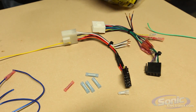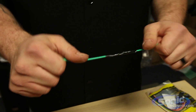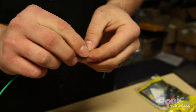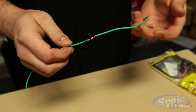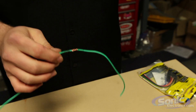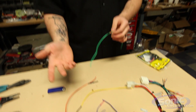Now, we got connections that you don't want to do. Quite a few different varieties I've seen in the industry. You get the twist and tape, which obviously you can see right there just comes right apart. It's where the consumer will do the do-it-yourself install, or I've seen other stores do this as well. They just twist it and tape. Well, what happens? The tape after time is going to unravel with heat inside the dash. Once that unravels, you're going to have some nice shorts and blown fuses — a lot of headaches. I've also seen wiring nuts used for home applications — those fall right off. I've also seen bubble gum, masking tape, medical tape. Anything that you probably think of, I've seen it.